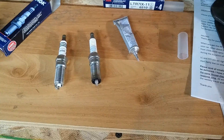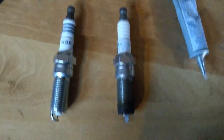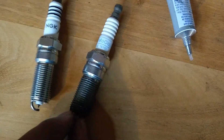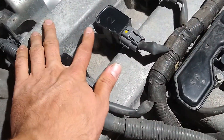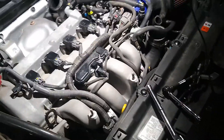Take a look at it — FoMoCo, Ford Mazda Motor Company or something to that tune. These are OEM. At 47,000 miles, these are the original ones. They're saying we should replace these every 15,000 miles. I don't know what these are rated for, but they are original, and these new ones are looking much nicer, so I'm happy we're actually changing them. They don't look terrible — the tip looks all right, not fouled or too ashy. Pretty straightforward process: just removing the 8mm and the electrical connector on each one. Done the first two, going to do these two.